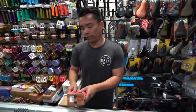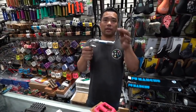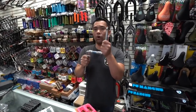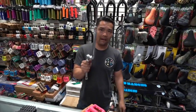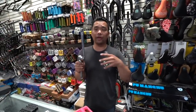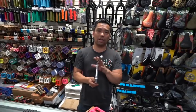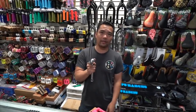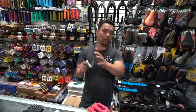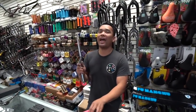9/16 usually refers to a one piece crank. A one piece crank comes on a beach cruiser, a very, very low level bike, or an old school bike. All one piece is 1/2 size. I could be wrong, guys. I'm not saying I'm perfect, but I myself have never seen a 9/16 one piece unless it's modified. This one actually has been modified to make it into a 9/16 by a friend of ours because he wants to use different types of pedals. But for the most part, all the one piece out there are 1/2 size.